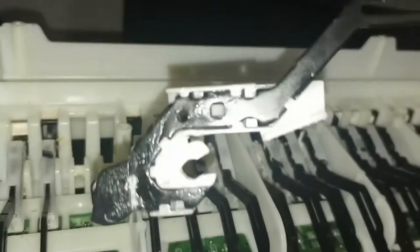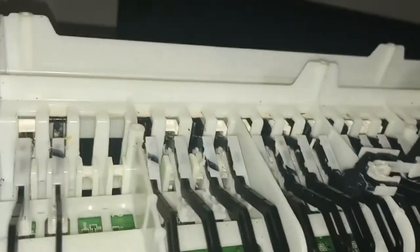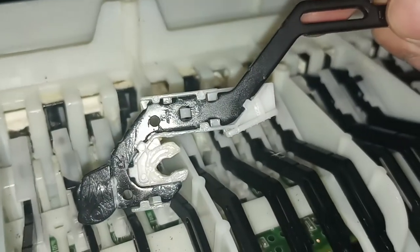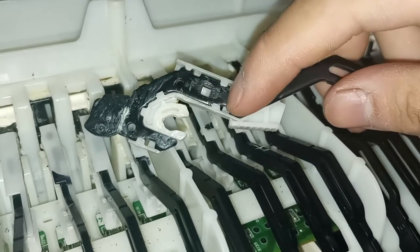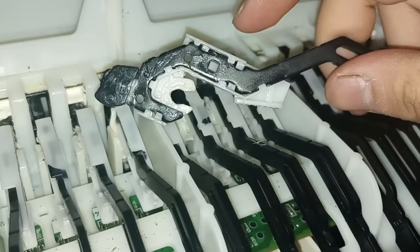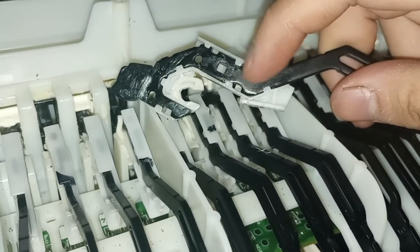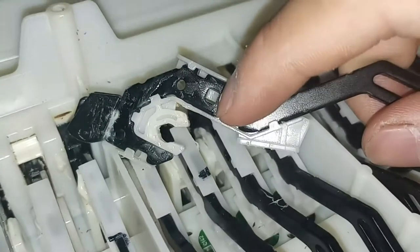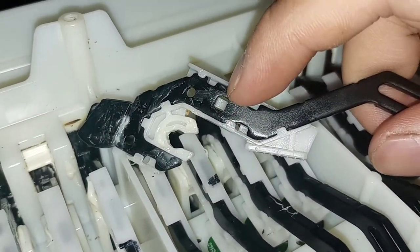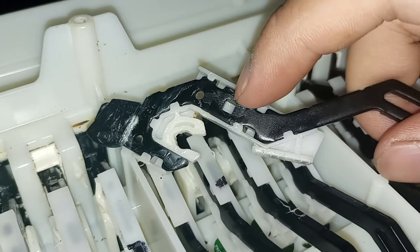This is the damaged one — or the one that was damaged. I just bent it back with a pair of pliers. When you bend it back, there are these slots in there. You slip the hammer into those little slots — one here, one here, one down there, and one back there as well. Slip it down and pull this plastic piece back, or push this hammer piece forward where my finger is pointing. You can see it slipped in, and there's a little snap thing right in the middle — you'll hear a small click. That's going to hold this plastic piece on.